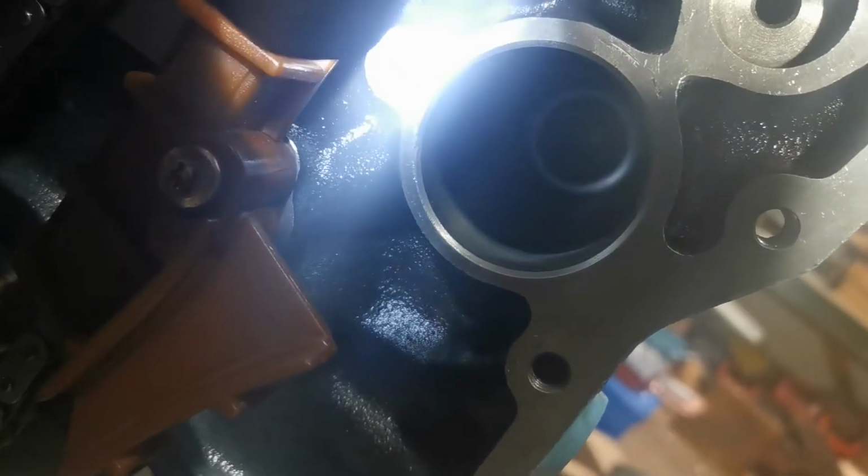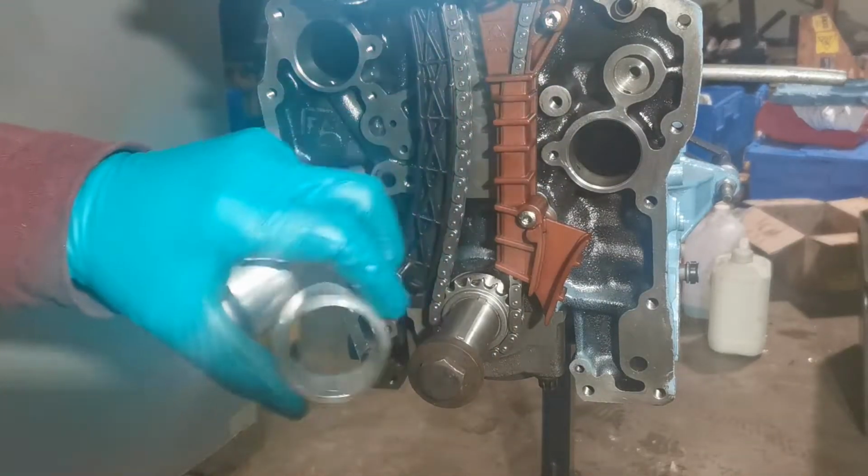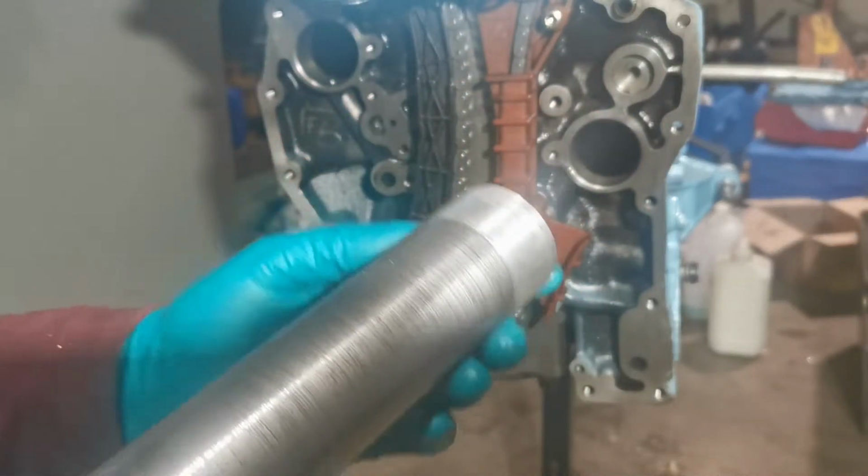So I've just got the other back one in there, as you can see. Now to get the front ones in. If you make these off the same aluminium round bar, then you can just use the same diameter, like so. Pop it back on, little chamfer end first.